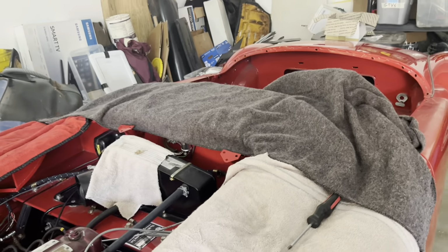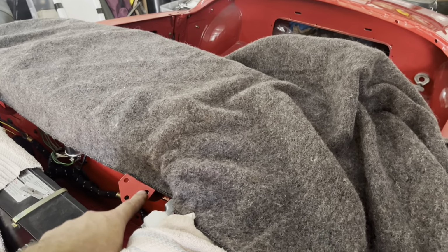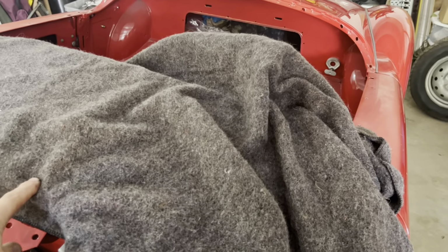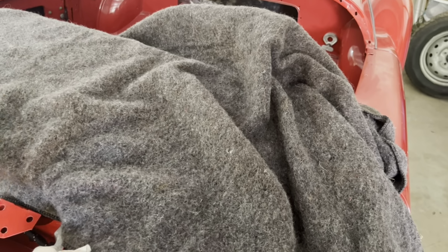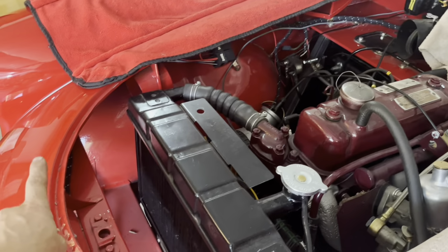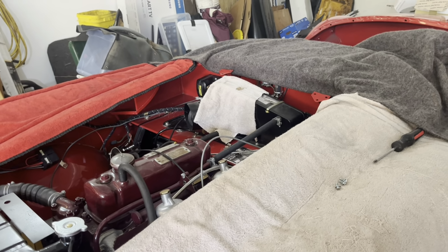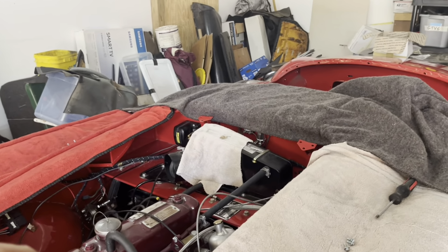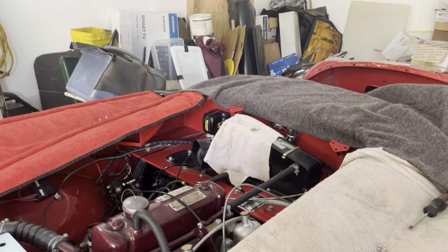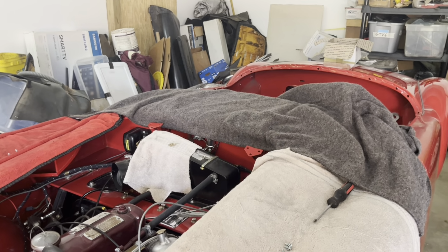And then you got to be very careful when you're setting it down to make sure it's all lined up, because you got movement in the hinges and movement within the hinge to bonnet connection. And it's always super close here, getting it all to clear the cowl here and not touch up here. These are a really tight fit. It's almost every one I've ever seen, that opening needs to be about an eighth of an inch longer to give the clearance that you really want to make it all fit perfect. So it's always a tight fit and not a lot of room for error on these.